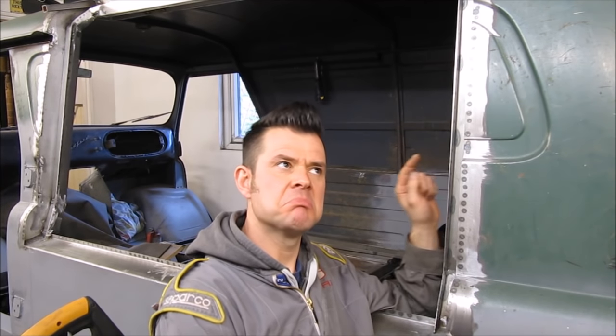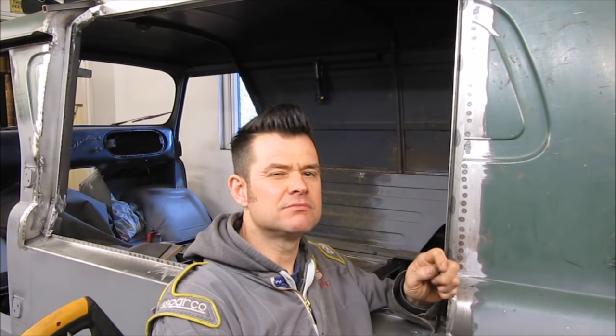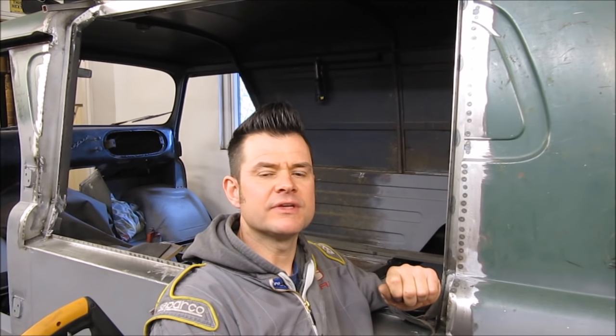Now seal compression needs to be around 12 to 14 millimeters. At the extremes, it can work at around about 5 millimeters to about 20 millimeters. Now it stands about 20 millimeters tall, so 12 millimeters, I feel, will be about the right rate for the seal to compress. And this is what it compresses on cars that I've measured, around about 12 to 14.